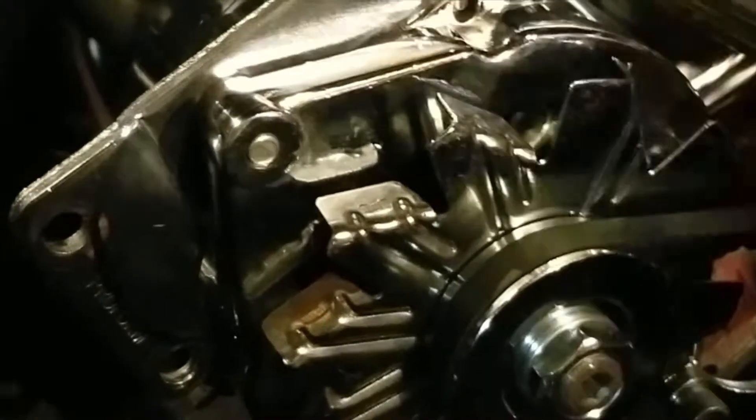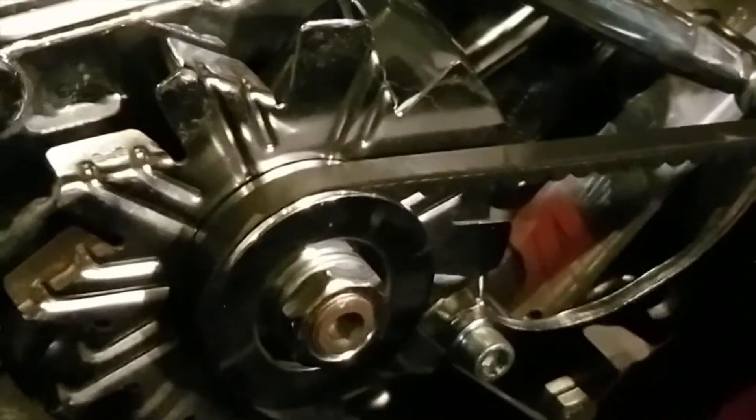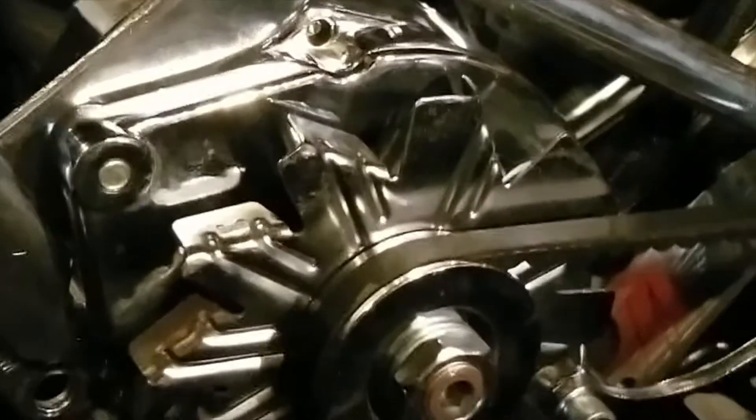You really only need two, but I used a curved piece here because of the angle I needed. Without something that curved up like this, it would hit the alternator when I pulled it to adjust the tension. When I put that bracket on, it worked in two areas: one up here and one down here. It helped brace it so the bracket would move to a certain point and then stop, and I'd get the tension I needed. I still want to eventually chop this off and make it a little cleaner.